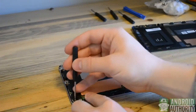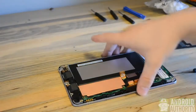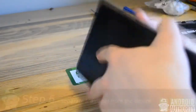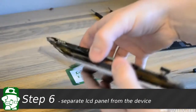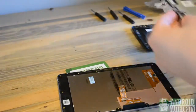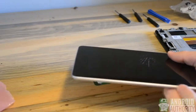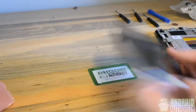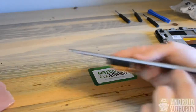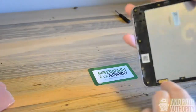Those will remain out of the way as we get started on removing the screws that surround the body of the Nexus 7, and we simply go at those with a Phillips head screwdriver. When we reach our final screw we can simply remove the motherboard from the LCD panel. The bezel will be attached to the LCD panel as well, but we'll grab the motherboard and guide it outwards. What remains is the LCD and digitizer.